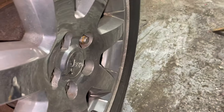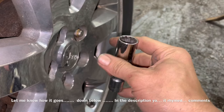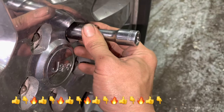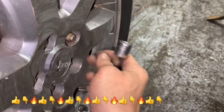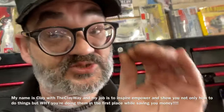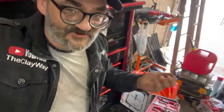This is a common problem you're gonna have in your driveway. These lug nuts are 19 millimeter, and 19 millimeter is right around three-quarters inch. We want to use a 12-point socket. The 12-point socket is not gonna get ruined in this situation — it barely fits over it. What we're gonna do is bang this socket onto the lug nut and hopefully remove it. This method will work on any lug nut — doesn't matter if it's a locking lug nut or whatever. If you have a 12-point socket that's just a smidge smaller than needed, you're gonna get it off.